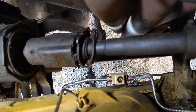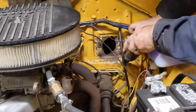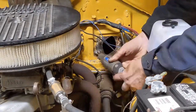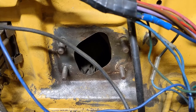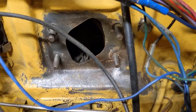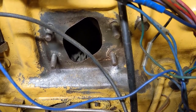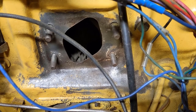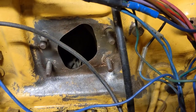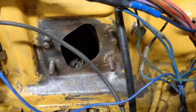We've got all the lines hooked up except the ones that come up to the master cylinder. Next, we've got to clean up this area and get the master cylinder mounted. It turns out the metal here is actually in really good shape — a little pitted, but not near as bad as it looked. I think when this was painted, the master cylinder simply wasn't taken off, so the area around it just never got prepped very well. We got it cleaned up, hit it with some primer and some color match paint, then we'll get this master cylinder on.